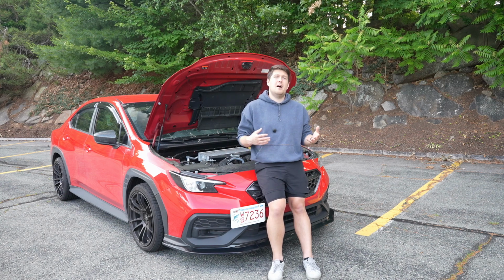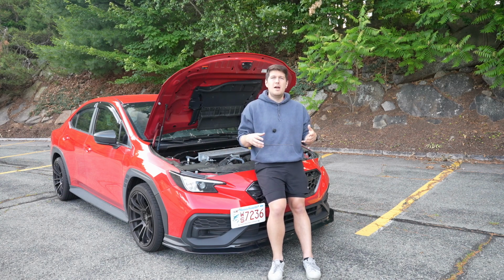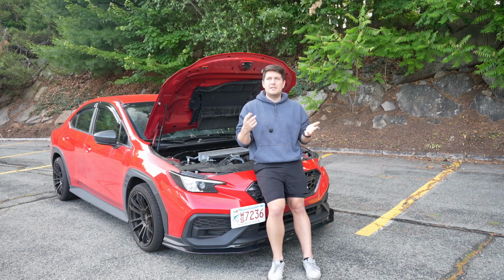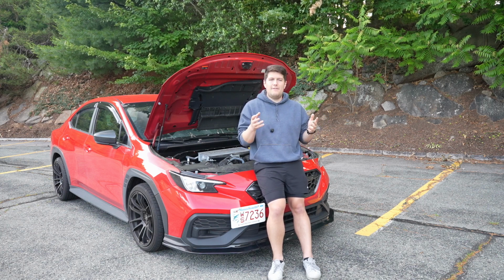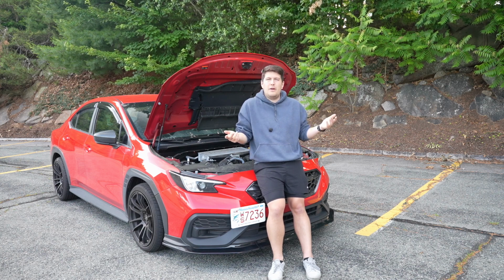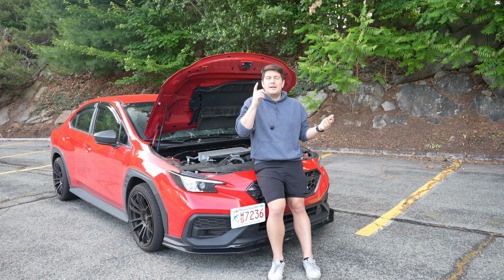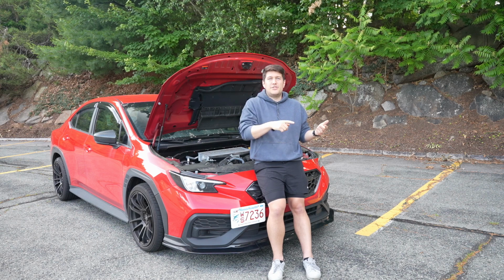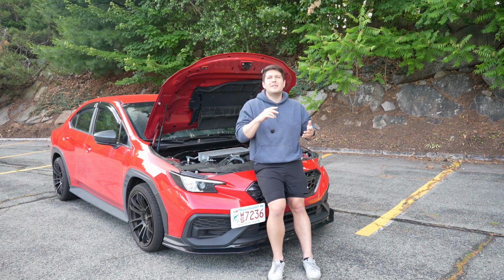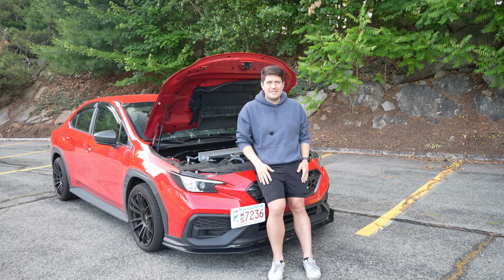You can also understand how much oil is actually in the air by pulling the bottom of your intake off and just doing a finger swipe. And some cars, they're not all equal. I've had two VA WRXs where it was like nothing ever, so I never ran an air oil separator on it. The WRX intake that I pulled off the 16 WRX that I've been rebuilding was full of oil. Not full, but enough that I'm like, oh crap, it needs an air oil separator.